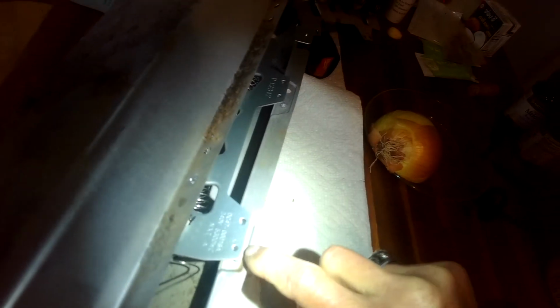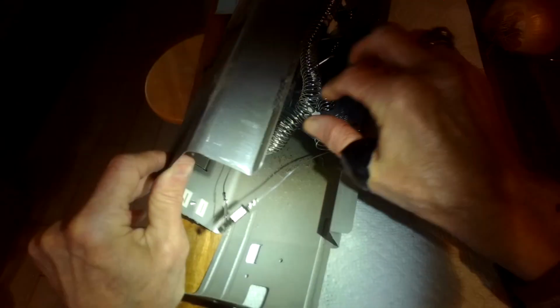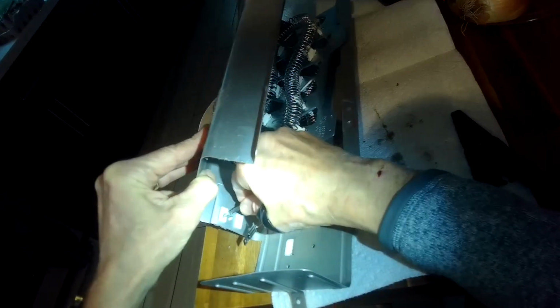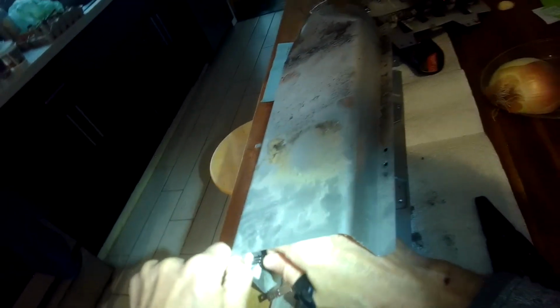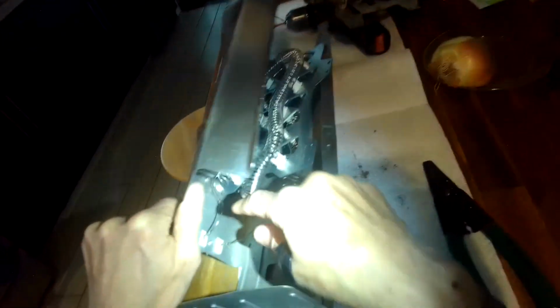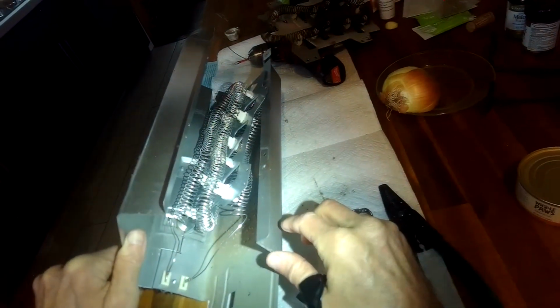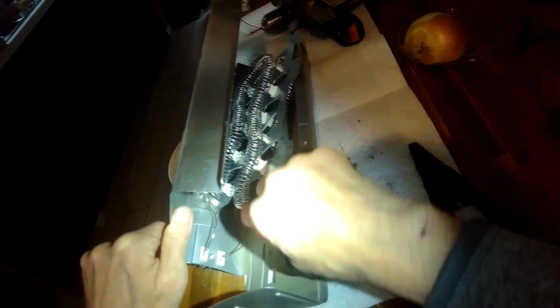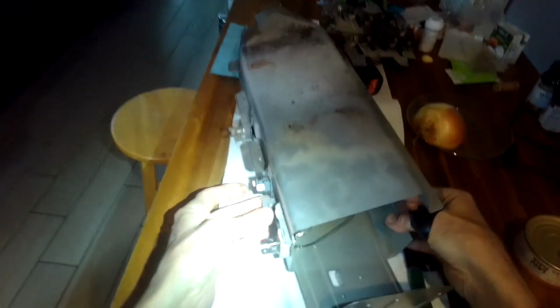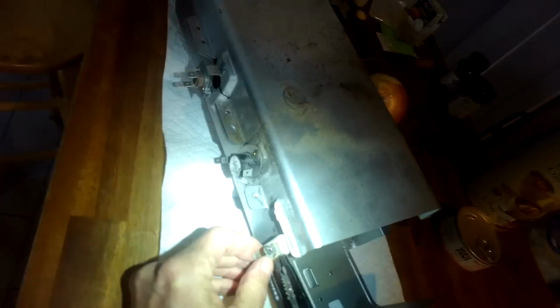You can see that it's kind of given away here. Line up those holes. And these are going to go through on top. Make this one go on the bottom. There we go. So I'm facing this, the one on my left, the one in the top, and the one on my right, and the one on the bottom. That looks good. You got to make sure that this metal coil doesn't touch each other, nor does this metal touch the frame when you close it all up, because that would cause it to constantly be on or cause a short circuit.